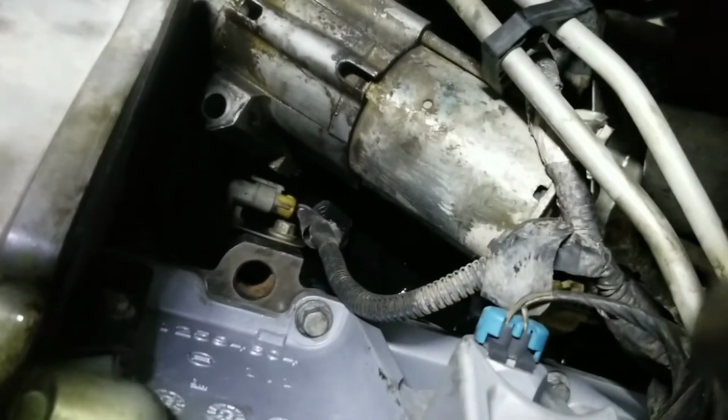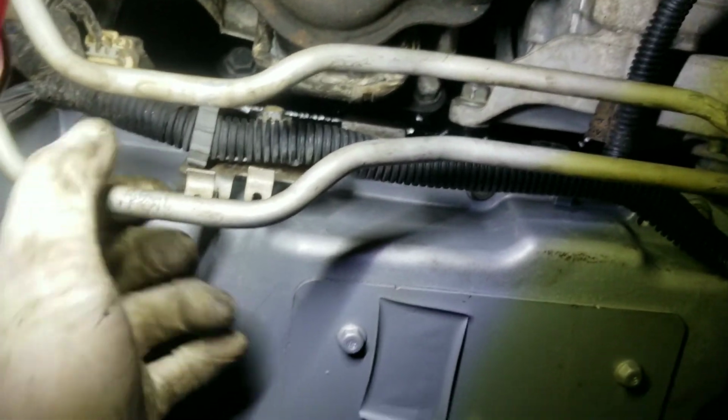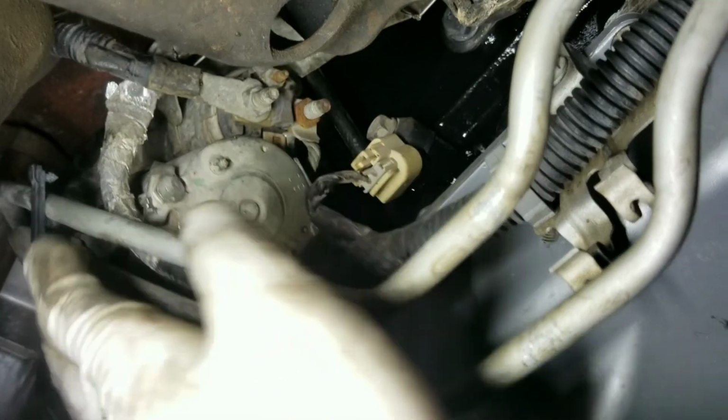All right. So once you remove the 2 bolts and the starter is loose, you're gonna push it back up. But you're gonna get these transmission lines off the little hook. Let me show you. These are 2 transmission lines that we're holding to these hooks. Just push it up so it can hook. You have more space. You're gonna put the starter going up, and now you have better access to the cables.